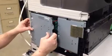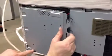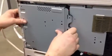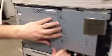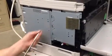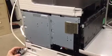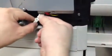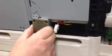This panel fits on the inside of this metal panel and can be a little bit tricky. You've got to get it over this ear and then in. Up here on the top, sometimes you have to press down a little bit to get it to slide under there. Then it fits up and we'll put that middle screw back in. For the hard disk drive cooling fan, I found it easiest to plug in the connector first, then take your fan and with a little wiggle it'll slide right into place.